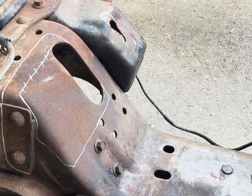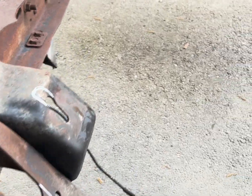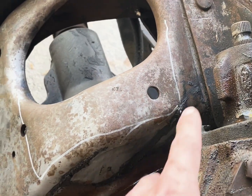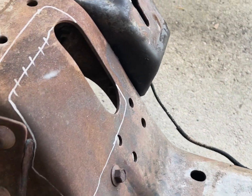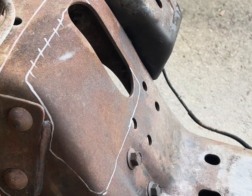I've roughly marked out what we're taking out here. First, we're going to have to elongate our holes a little bit for the motor mount bolts to go through. And then this is where the alternator is going to sit — probably going to have to do some more cutting there. And then down here, all the way across, is where the AC compressor sits, and I'll just come back and weld this back together.